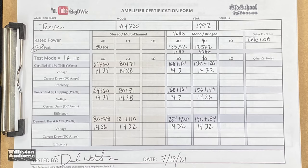Could be better: doesn't have any crossovers on this model, the speaker output terminals are those hateful push terminals, the power and ground wires are short, the coolness factor — Jensen is not the best-known brand. It is big and inefficient, unfortunately, due to the class AB design. Thanks for watching — I hope you guys enjoyed this throwback video of this budget Jensen amp from 1992 to about 1994 for this particular model.